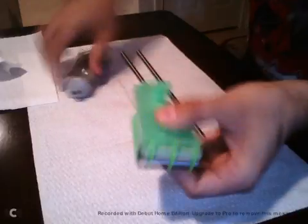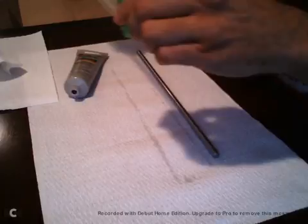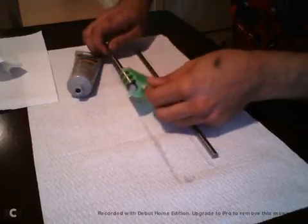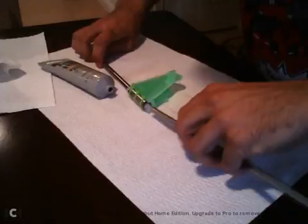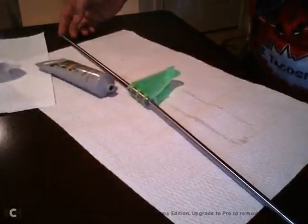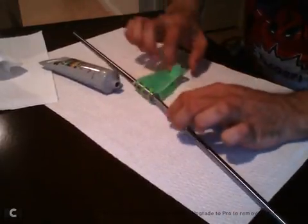I've created a grease plug inside the bearing. When I push the rod in you can see the plug come out — it gets sprung right in. Now I withdraw the rod so the plug gets sucked back in, and I push the rod in from the other side at the same time, minimizing the amount of air in between the two rods, then push both rods together.